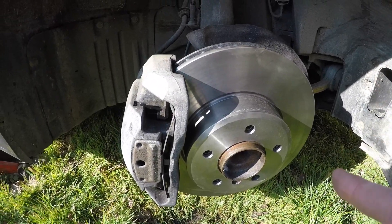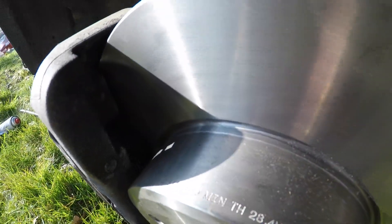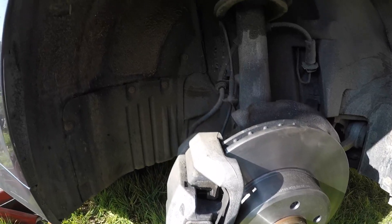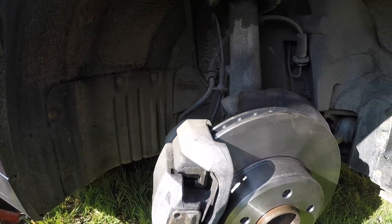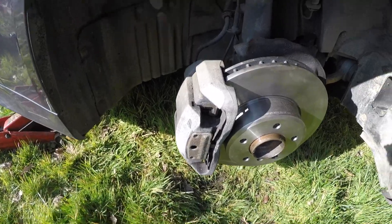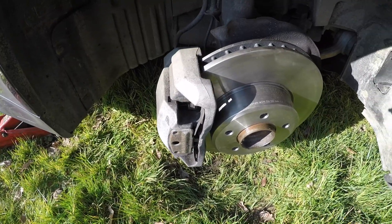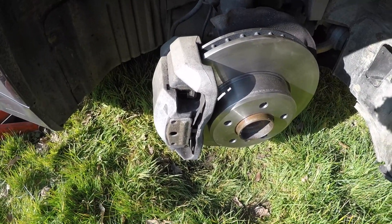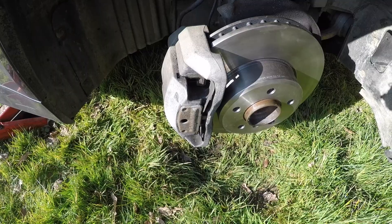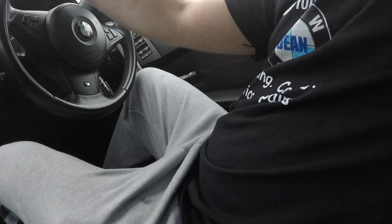As you can see, the brake discs are now back on the driver's side — look how shiny they are. The new pads are fitted with full meat on them. I'm very happy with how it's come out. I didn't have to change the brake pad sensors because they weren't even worn. Now I'm going to put the wheel back on, pump the brakes, take the car out to let the brakes bed in, test the handbrake, and then we're going off for MOT to see if the car passes.